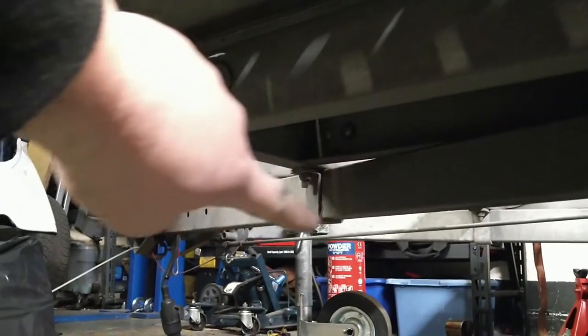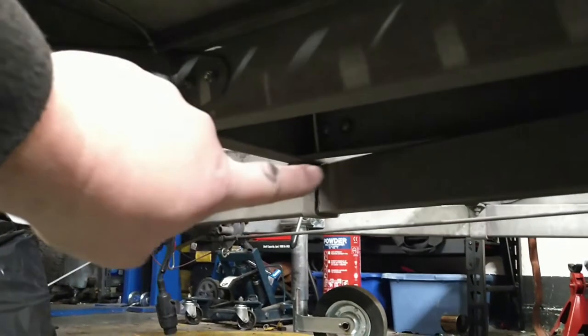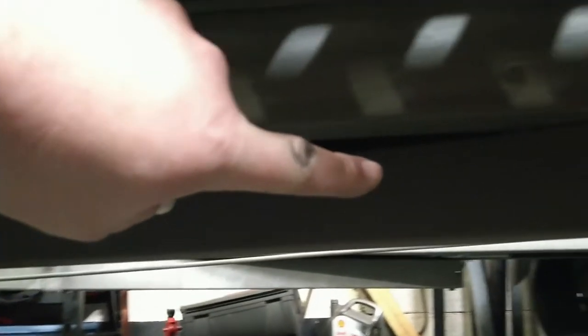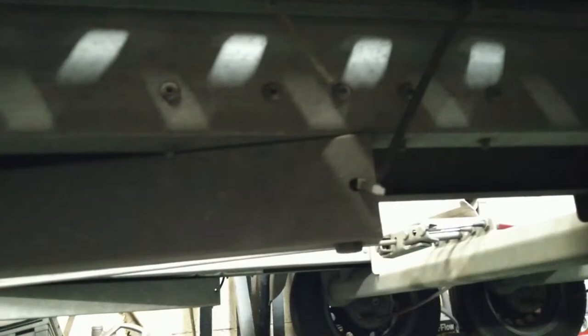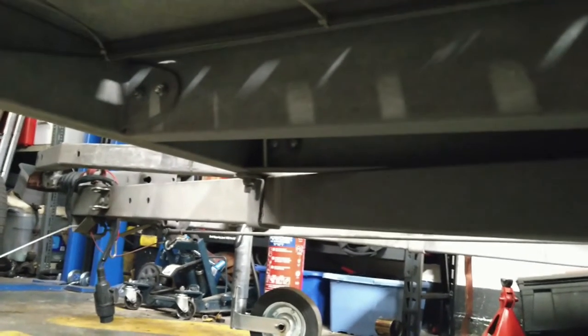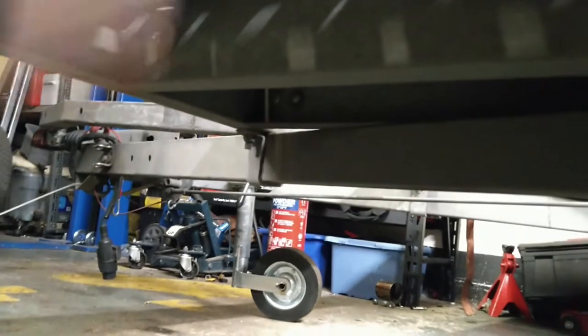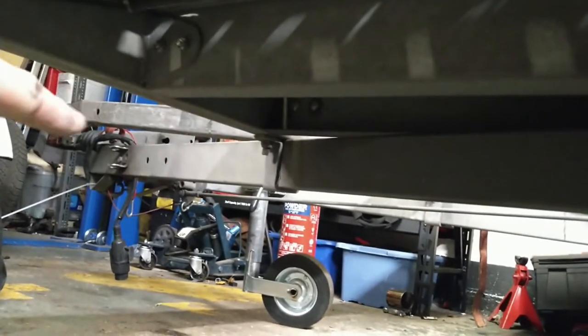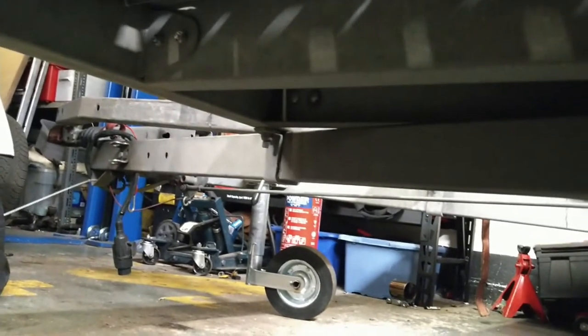Looking beneath the trailer — here's the trailer arm, and there's the arm that the winch is going to mount to, bolted on there. This rail of the trailer ends there with another bolt through it, so I think the easiest thing to do is just to drop that down, support the trailer on some jack stands, and then slide that winch mounting arm to where I need it to be.